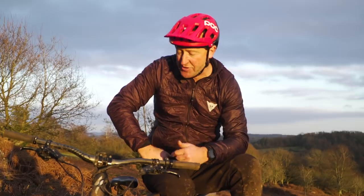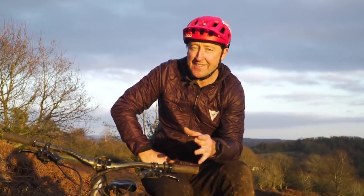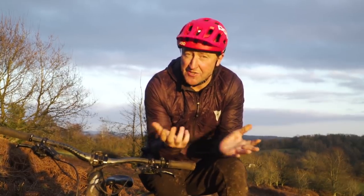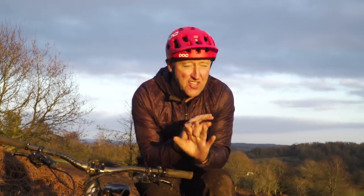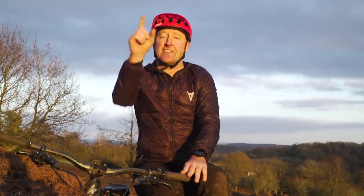Overall in this video, I think we've found out what we set out to achieve: the low profile, narrower, harder compound tires are better on battery consumption than the sticky tires. This is really important for riders going for big days out on smooth single tracks, fire roads, and grass conditions. It also has an effect for enduro racing — not only in range but also in times on liaison stages. Let us know your thoughts on tires — what tires, pressures, compounds, and tread patterns you're using, as it has a huge effect on tire range. Give us a thumbs up if you liked the video and subscribe to EMBN.